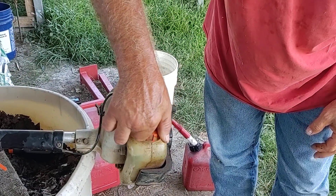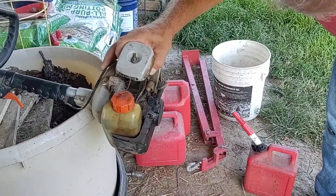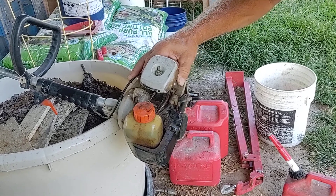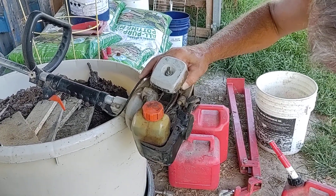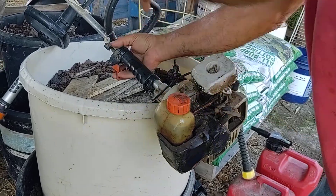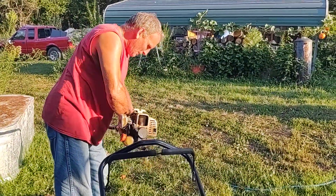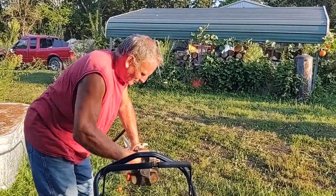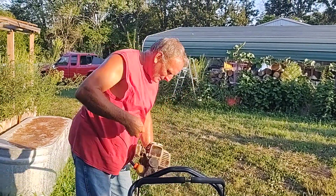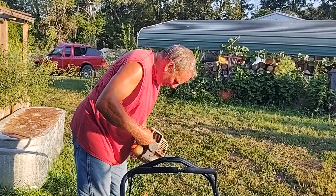The prime bulb is working. I can see we have a gasoline leak at the holes though. Got gasoline in the engine. I let go of the trigger.